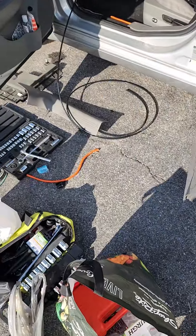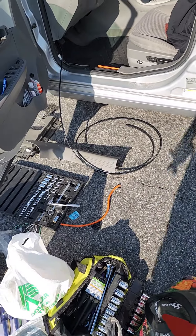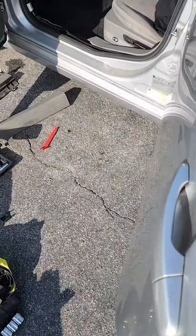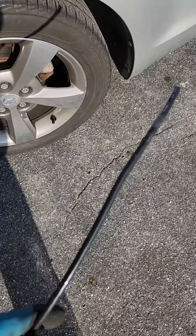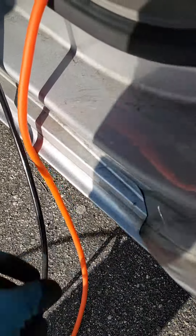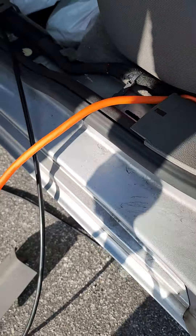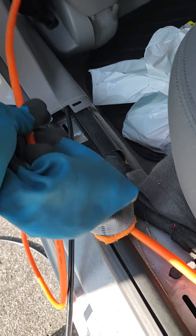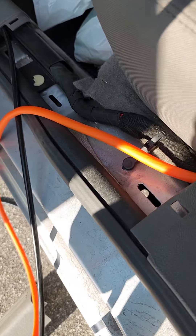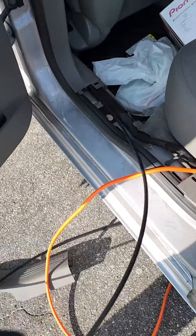I'm going to run it back and pop it into the distribution block — it's just tracing the old orange wire, so that's nothing, already done in a previous video. I'll never use CCA again. This wire came through so easily through this whole thing because it's stiff — you could bend it straight. I bent the front of it straight and just fed it through so easily. The first install of that flimsy spaghetti noodle, it took me so long to get it through and I couldn't pop off the seatbelt cover. That CCA is extra thick for nothing because the actual wire inside is a smaller gauge. I'll never use that stuff again — this is what you want.